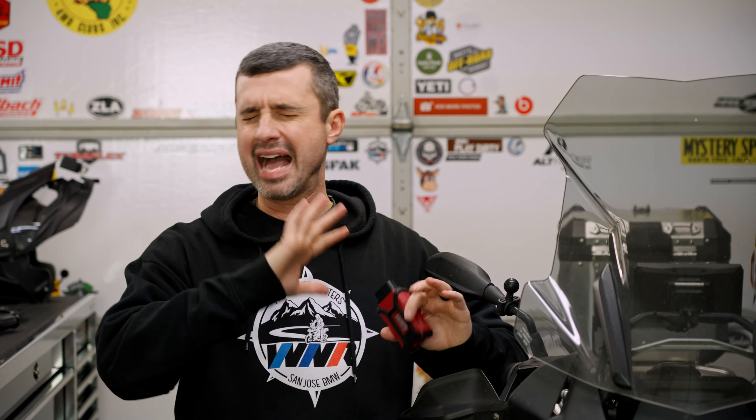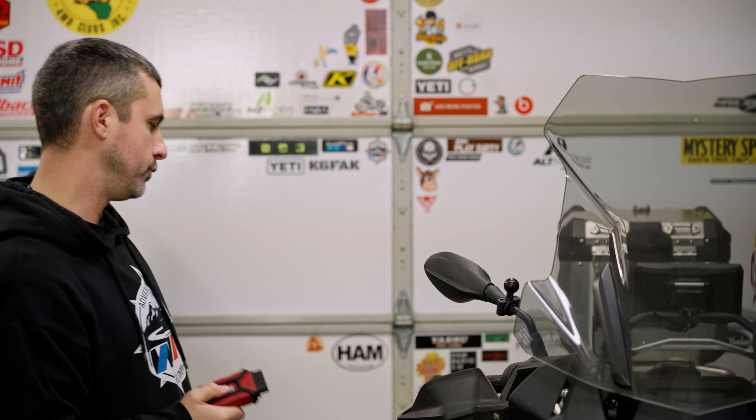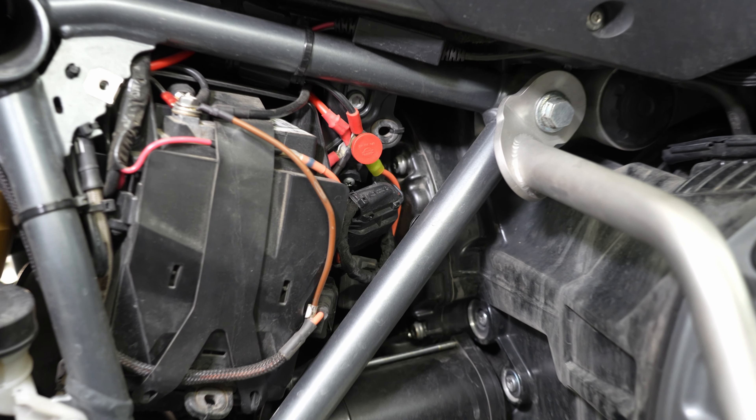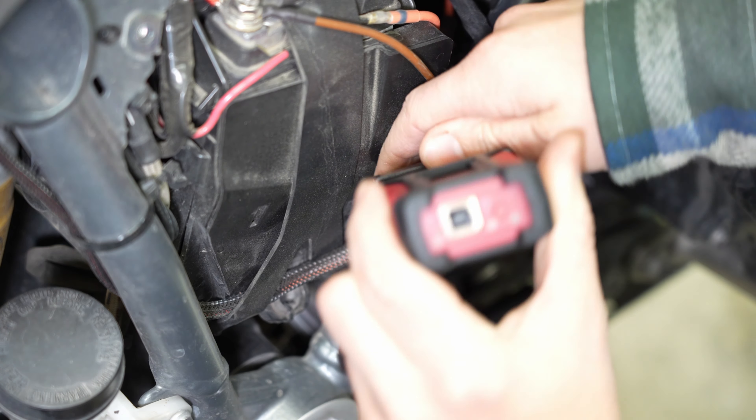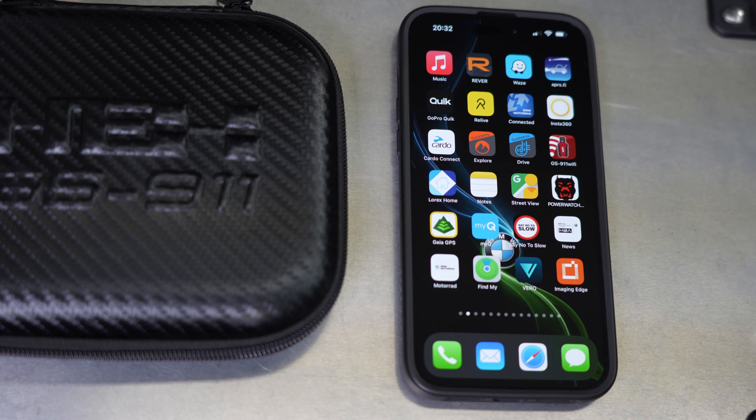Getting back to this scan tool — I saved up for a little bit and bought it. I think this is a great buy because it does so much more than just reset the oil service light. If you've got suspension problems, if you're changing other components, or if you want to read different telemetry — I'm not going to get into everything it can do in this video. But the next step in changing your oil is to go over to your right side where your battery is, use a T25 to take that little cover off, and you're going to find a DLC — a data link connector — the same one your car has if you have a newer motorcycle. You plug this in, use your smartphone, and reset your oil.